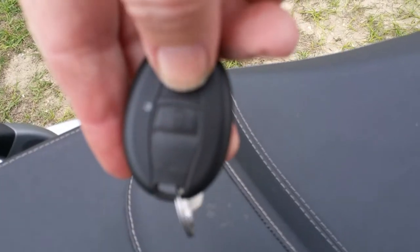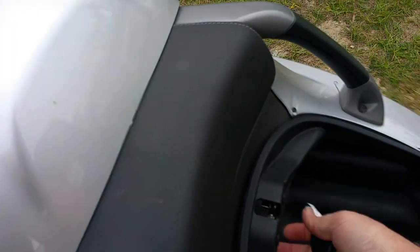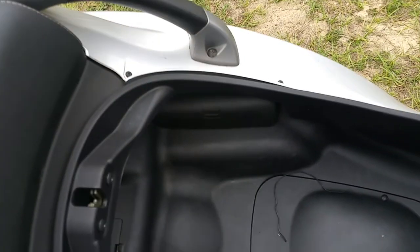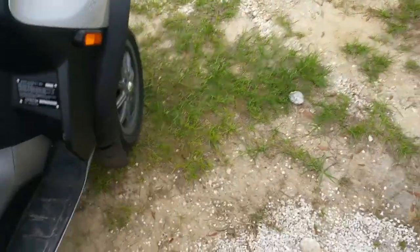The hatchback is popped open. The seat lifts — there's a button right here with a picture of an open seat cover. The seat is electrically operated; if the battery's dead you've got to get in from the back and reach underneath and grab a little cable to unlock the seat, because you can't get to the battery without taking these screws out. That's why I always put it on a battery tender in the winter. And there you go — a Piaggio MP3, made by Vespa.